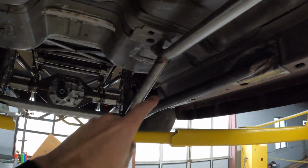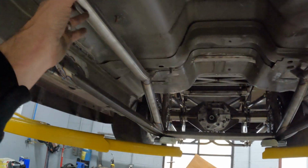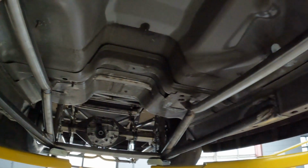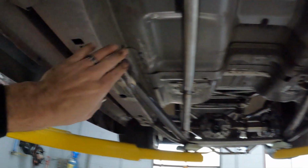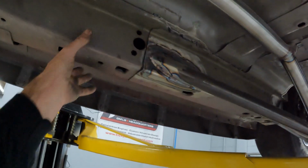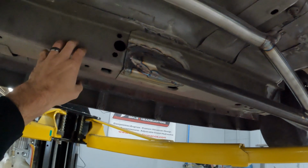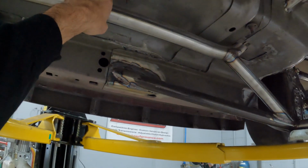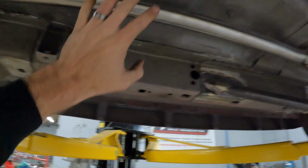So just some support for the 4-link, the lower part of the bracket here. It's required by all these 25 whatever cages. These are your 2A bars. So these don't count. Even though these are big frame channels, this is still just stamped steel. This is unibody stuff. It's not part of the frame. We thought maybe it would count, but it don't.